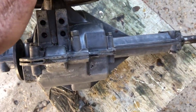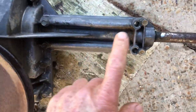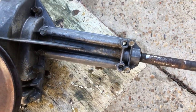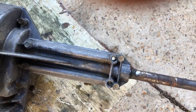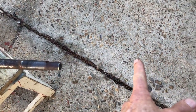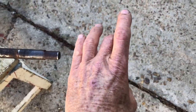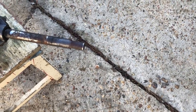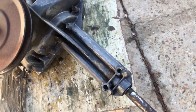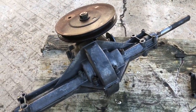It's a true differential. It looks like it has bushings instead of bearings here, and I'd prefer bearings, but it's too narrow. When I extend these shafts out or add to them, there will be a bearing outboard which will hold the weight of the cart, so these bushings are mostly handling torque. A riding lawnmower should be designed for plenty of torque with a 16 horsepower engine, so that should be fine.